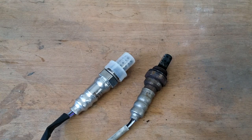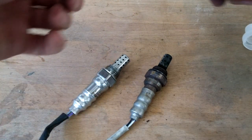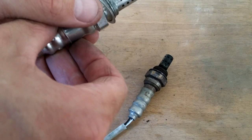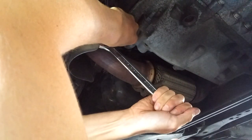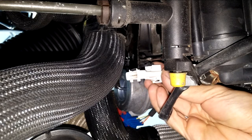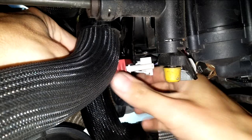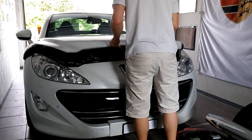Let's compare the old with the new one. The new one is not exactly the same — it's a little bit wider and has more holes in it, but it will work just fine. Before you install it, put some anti-seize on the thread only — I used copper grease — but be careful not to put any on the sensor itself. Throw it back on and fasten it just a little bit more than hand tight. Reconnect the cable to the bracket in the middle and the connector to the end bracket. Now reconnect the two cables while firmly pushing down the red button. And we are done!